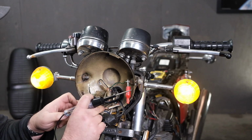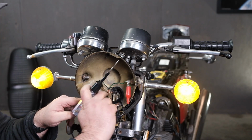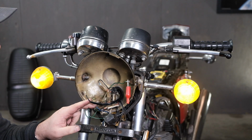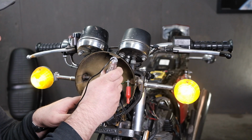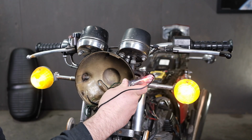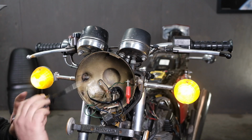And I also have a bundle here of solid black wires, and we know that solid black wires are 12 volt positive back to the battery. If you haven't watched that video on the 12 volt positive circuit, make sure you do that. And therefore I have power from solid black. I got a good ground connection.